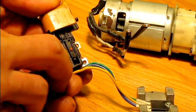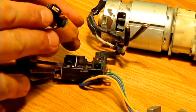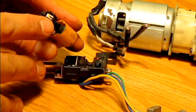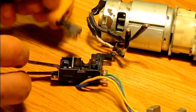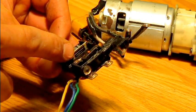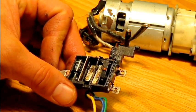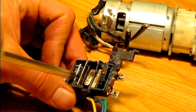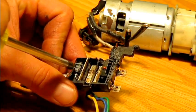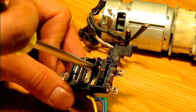This is a spring which gives the force of your push back on the trigger. On the trigger itself there are two contacts which slide up and down against two rows of resistor strips inside the trigger. These, I'm assuming, are the brake, which is the problem I was having. I just have too much dirt and grime built up in here, moisture over the years has corroded it. These contacts I could probably replace — I tried cleaning them but I'm not having any luck getting the brake to work.